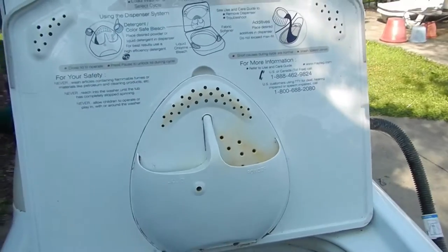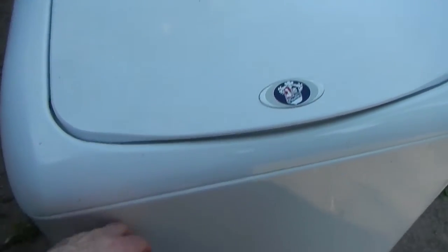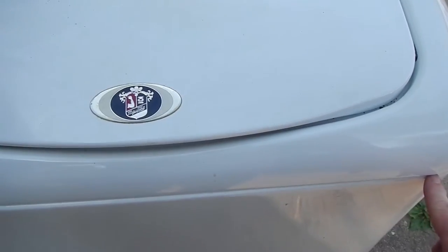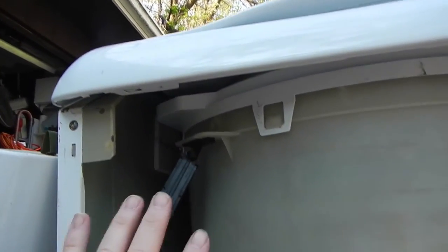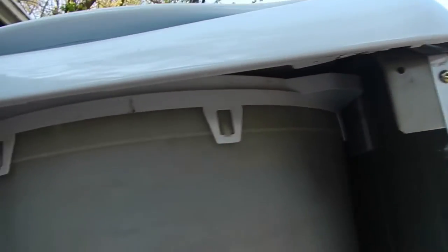Let's try to figure out what the actual problem is. First of all, you are going to have to get off this front panel here. To do that you are going to need to slip something thin into these corners here — one here and one over here — preferably plastic because metal might scratch your finish. I am going to remove this front panel and then show you what it looks like down inside. Those two tabs just allow you to lift the lid, then you will have to undo two screws, one in each corner, and that front panel will come right out.